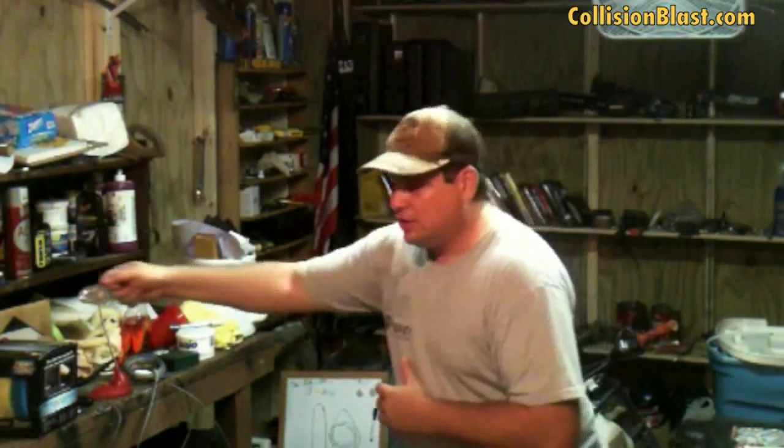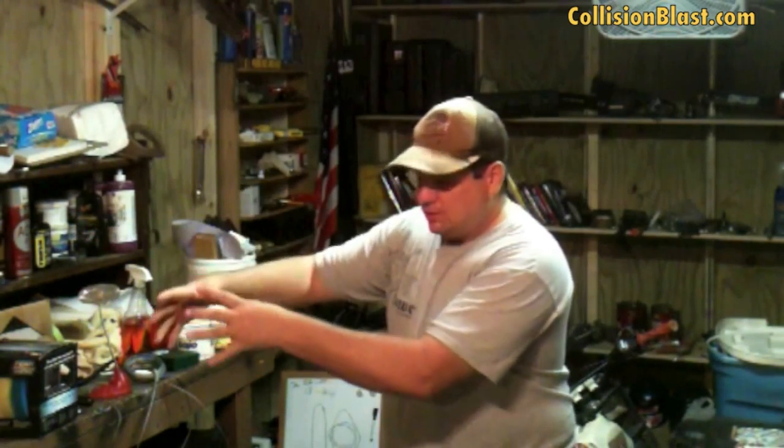But yeah, on top of panels, especially in the centers where you're reaching over and probably further away than you should be, that spray's going on real dry. That's where you're probably going to have that. This can happen in your base coat or in your primer sealer. I've seen it in both. Another cause is your air pressure being too high, with that fog of overspray going all over and landing on top. When it does, it's a dry particle, and it makes that rough texture.